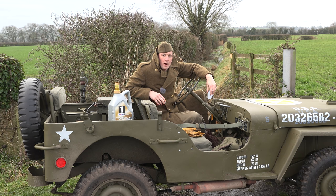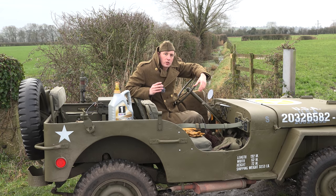I think you'll agree that 500-mile oil change is pretty incredible — I've never seen anything like it. There wasn't even a single fleck or shimmer of metal in that oil. It was completely clean. What's happened apparently is that the engine hasn't worn at all. The oil is a detergent — it's picked up a lot of the soot and crud which would form sludge and holds it in suspension. So it's quite black but there is no metal shimmer, no metal particles, nothing whatsoever, which is really impressive. The oil is doing what it says on the tin — it's keeping your engine like new.